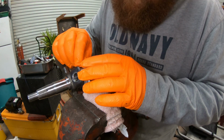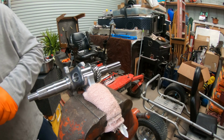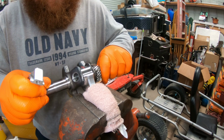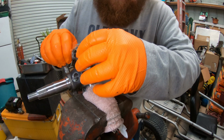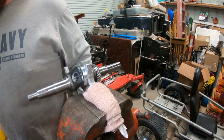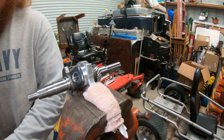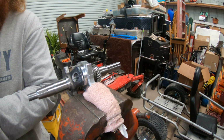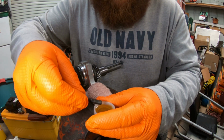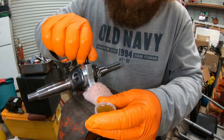And we're just gonna lay it across the top. Then we'll take our cap. You remember the little dot? We're gonna line that up. The little dot right here. Put that down in there. Take our bolts and we're gonna dip them in some oil. So that little jug I had, we'll take just a little cap full. Dip them in oil. Thread it.